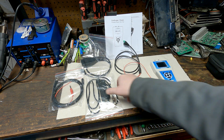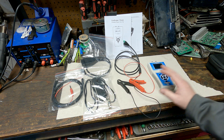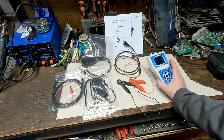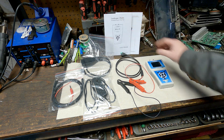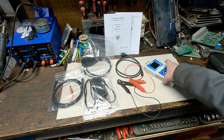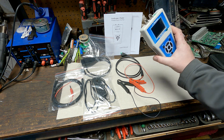There's also an ignition sync so you can pinpoint which cylinder you're having trouble with, or you can run without the sync and add an amp clamp to get better definition on your relative compression test. This is a pretty nice tool. It does come with instructions — I highly recommend you read them to understand the nuances. There is a battery inside; it doesn't come with one, so you'll need to put a battery in.